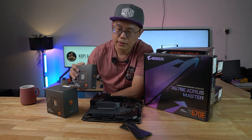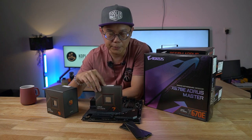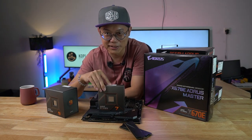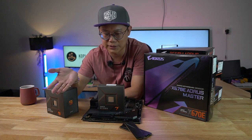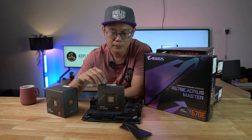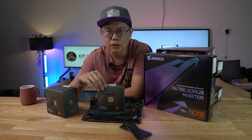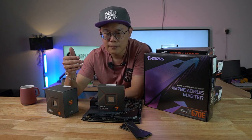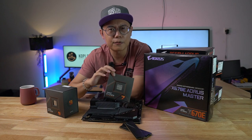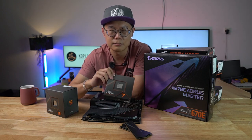Bear in mind, the Ryzen 7 is a little bit iffy. When we ran it out of the box, as expected, it actually hit 95.5 degrees Celsius, which is the norm for the 7000 series. But we felt the performance wasn't up to expectations. So what we did was go into the BIOS, undervolted to 1.2 volts, and knocked the temperature down to 85 degrees Celsius — and this thing just flew off the charts. It performed 5.5 GHz on all cores simultaneously on the Cinebench R23 multi-core benchmark. It's crazy.